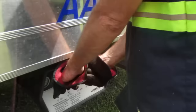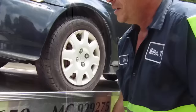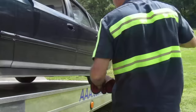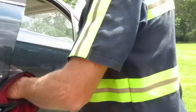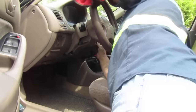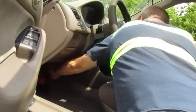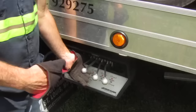As you see, my chain is tight — sometimes you might get a little extra snug just to make sure. Now here's the key: don't ever put them in your front pockets because you'll never find them. I keep them in my shirt pocket. Come back here, put your hand on the brake just to make sure, release the car into neutral, shut the key off, and pull the middle handle — the car rolls back.